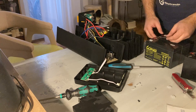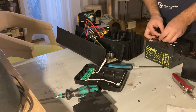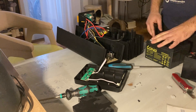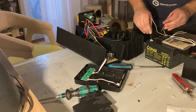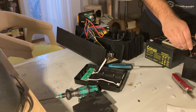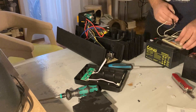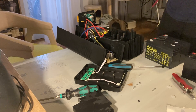We have this loop that goes from one minus to the opposite plus, so we have one connection and another connection - the positive connection. Let's check the voltage: this one is 12.84 volts, the other new battery is also 12.84 volts. The old battery is 13 volts... and 11.5 volts - so one of the two is apparently dead, possibly from heat.